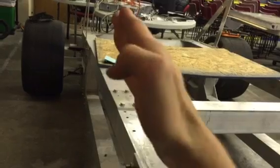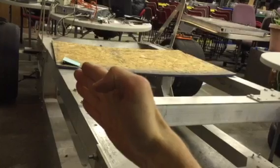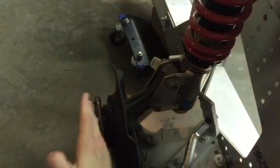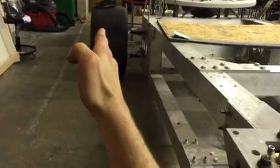This one was bolted together to avoid that, so the chassis is actually perfectly straight. But most people weld theirs. Since the rear is open to let the engine roll in and out to swap engine modules, the rear tucks in — meaning a lot of them have rear toe out. To adjust for that on your chassis, please angle the hub carrier. That's the thing that matters — the actual face the wheel attaches to should be in line with the front hub carrier, so they're both perfectly on a line on both sides. You can do that just by holding a long straight piece of material from one to the other.